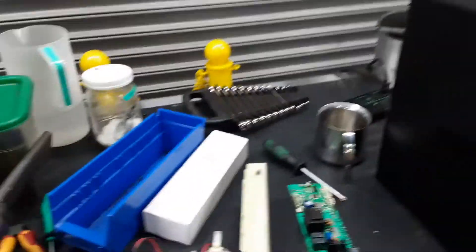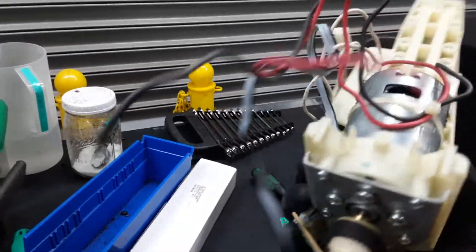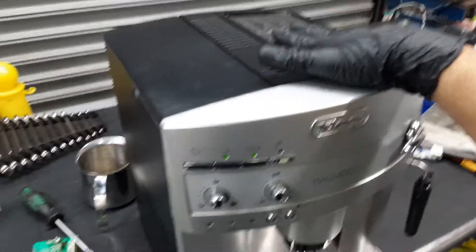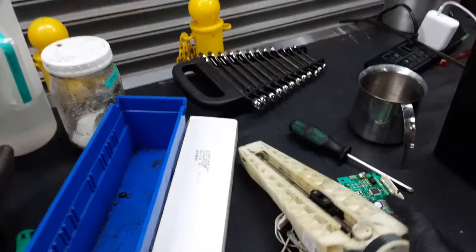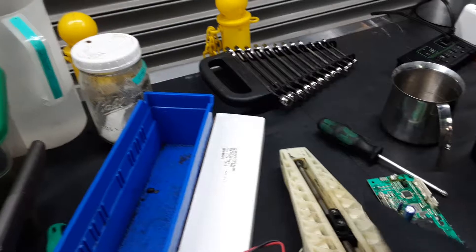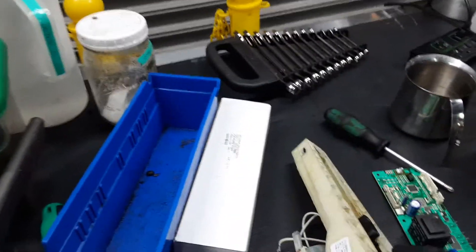For this machine we had to replace the brew unit — the transmission — since the brew unit was stuck on the upper position right next to the generator. The transmission was not able to go down by itself, so we had to manually bring it down, but once we did it just kept going all the way back up.